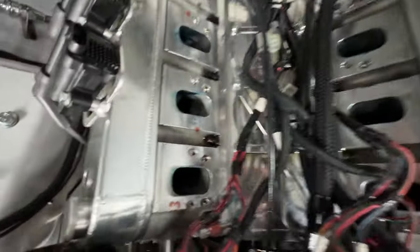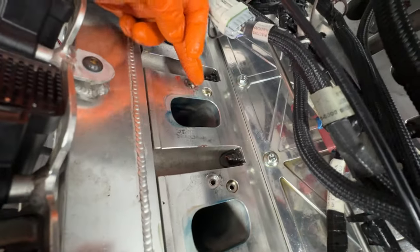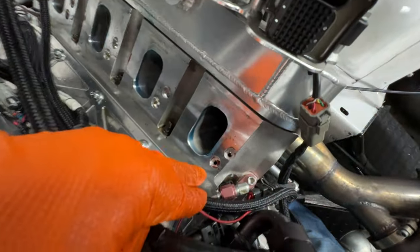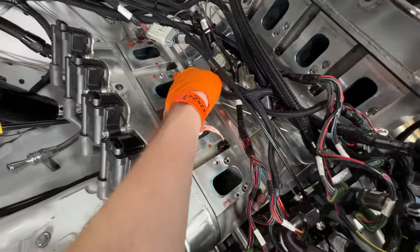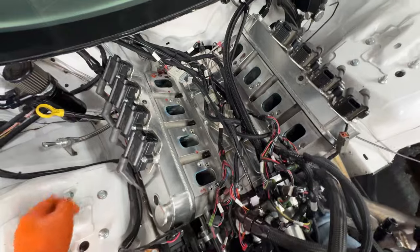But here we go. So, holes the intake uses, holes the intake doesn't use, and see all the oil. You can actually see where it's wet down around from this one. You can see where oil is puddling in that hole, that hole, that hole, that hole, that hole. Not that one, so maybe that one doesn't go all the way through, or that one was sealed by the gasket possibly or whatever, but gonna get all this oil cleaned up, and then we'll get new gaskets back on it. I need to put the little screws down in here. So I'm probably gonna tape up the holes, figure that out, so I don't drop a set screw down in the cylinder while I'm doing it, and then hopefully we can get back to going.